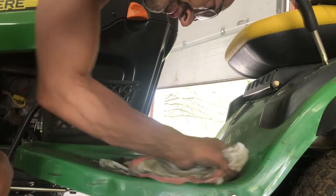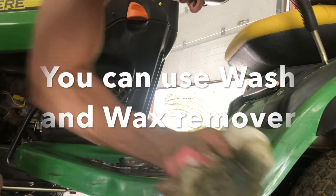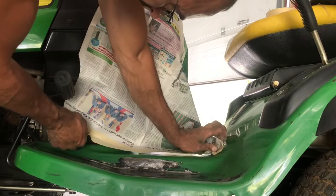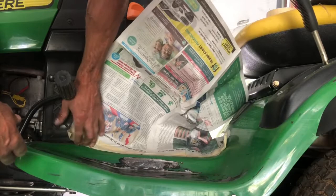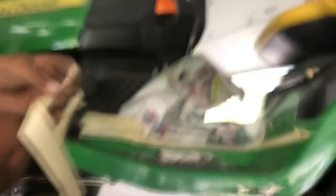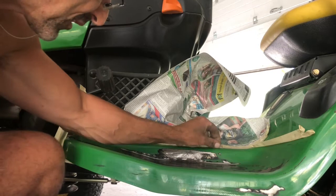I'm going to put a primer on it. I'm going to clean it up with lacquer thinner — be careful, don't go too crazy on this, it'll ruin your paint. I have my mask. I don't want my paint to go right there. I'm going to lift up on the edge here so it doesn't make a line, a ridge.